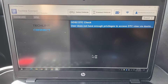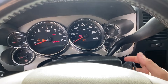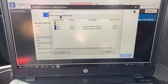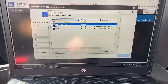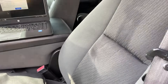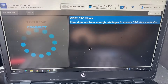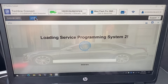It completed the update installation and now this is loading up. We're going to see if it'll recognize the vehicle — I need to put the key in the ignition first. Let me stick this in and turn the key on. We're going to click 'Connect Vehicle' and let this thing load up. It's going to ask what device we're using — in this case the Maxi Flash Pro — so we'll click that and hit continue. It's now giving us options for this VIN number. This is a 2009 Silverado two-wheel drive, so we'll select that, click accept, and now we are in.